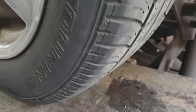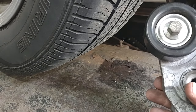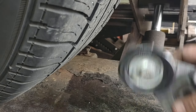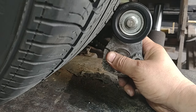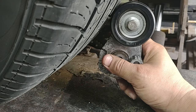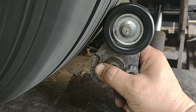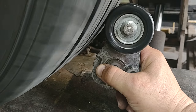I'm going to show you this with a belt tensioner that I use just to verify the noise. You could put your hands here and feel it — if it feels bumpy on your finger, that's the tire. Watch this: as I move the tire around you can see how much this pulley jumps, and you probably hear the noise. I'll move it toward the middle — you can see it's more steady, it doesn't make as much noise and it doesn't bump.